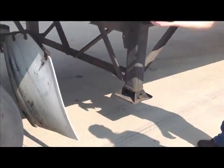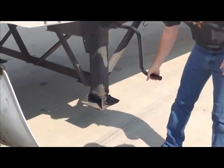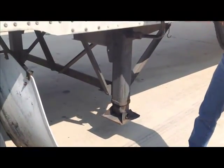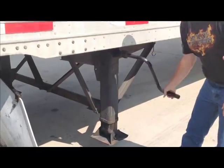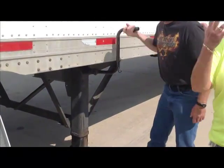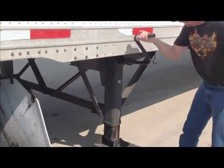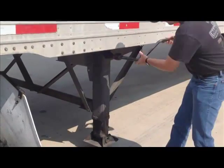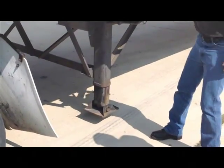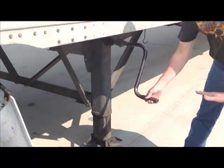It's kind of in between, I think. You gotta lock it in better. There we go. Okay. In is high gear. So you can see the landing gear going down. Now he's turning the handle properly. Some people stand with one finger and go like this. You'll do that until you get smacked in the face the first time. And then you won't do it anymore. Okay? You dolly it down. And the way you know when your load is fully supported, there's a way you know that. You're gonna let the landing gear hit the ground.